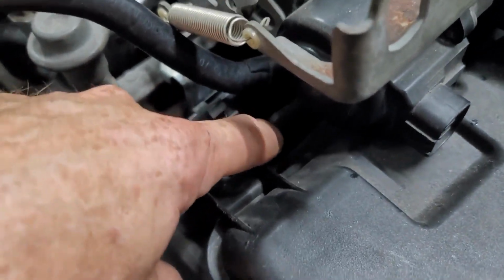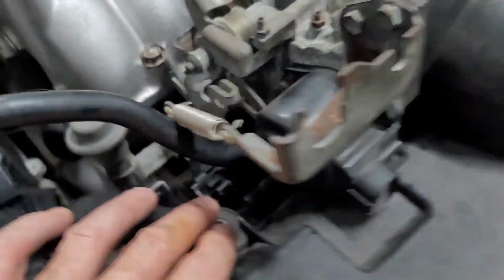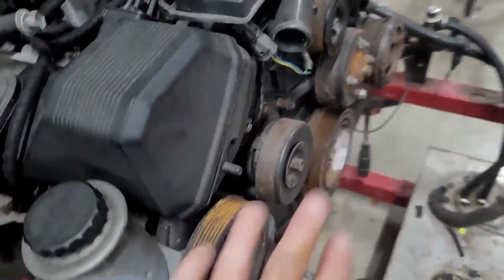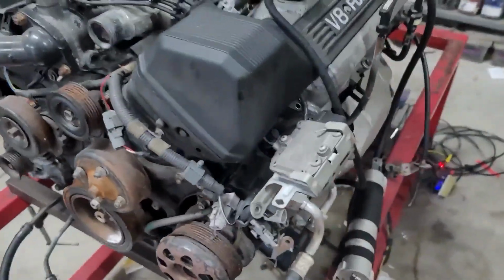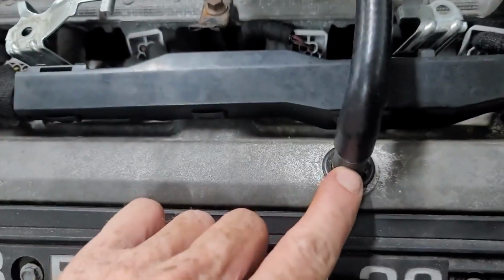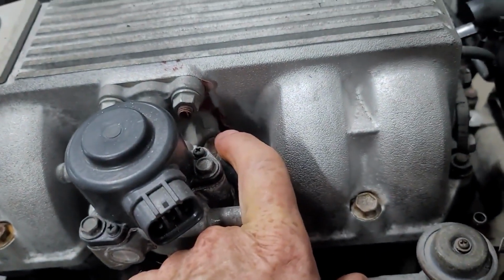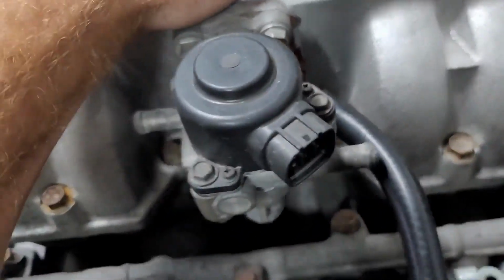Another thing to watch out for, a lot of guys make mistakes. You'll see on the right hand valve cover, you've got a tube that comes out and goes into your throttle body. That is an air supply for your ventilation system for the block. It basically pulls air through this pipe, so the air going into the block is also calculated by the airflow meter. It runs through the block, pulls out all of the smog, if I could put it like that, and it goes out of here into your intake chamber over there, and gets burnt up by the combustion.